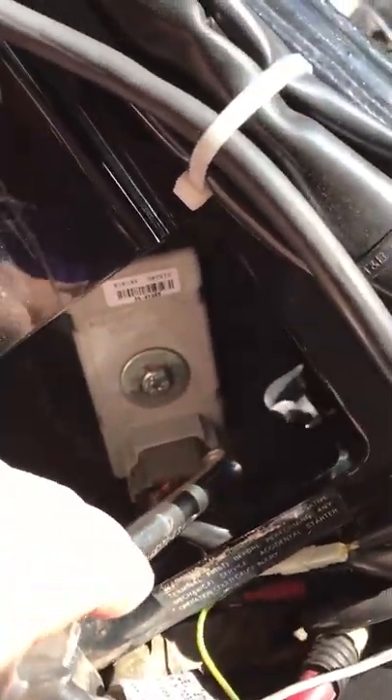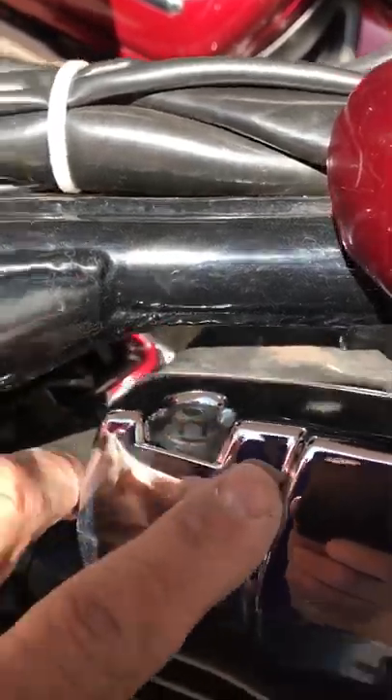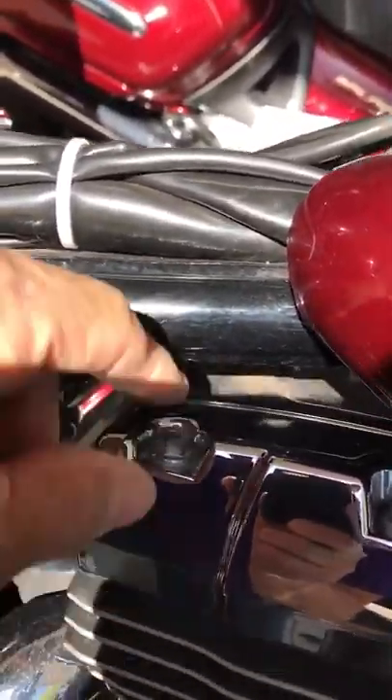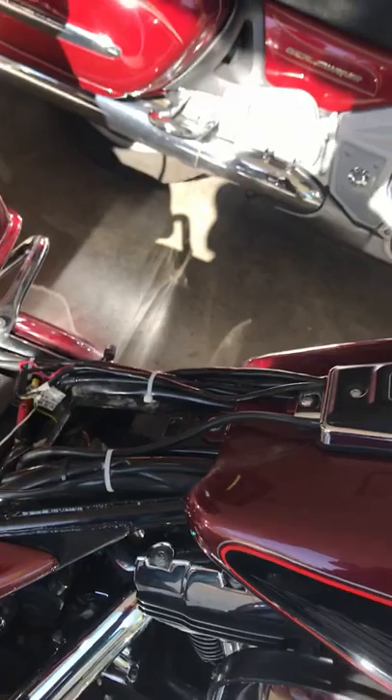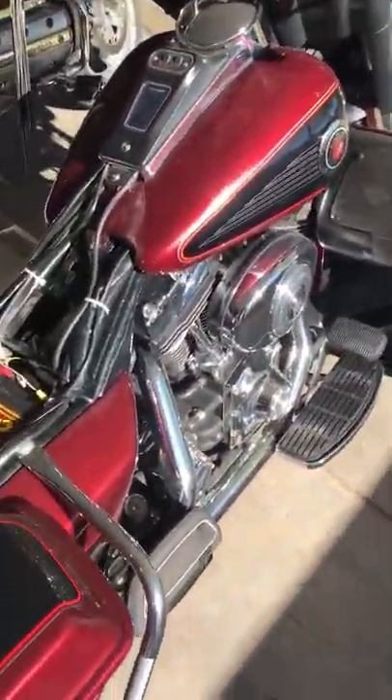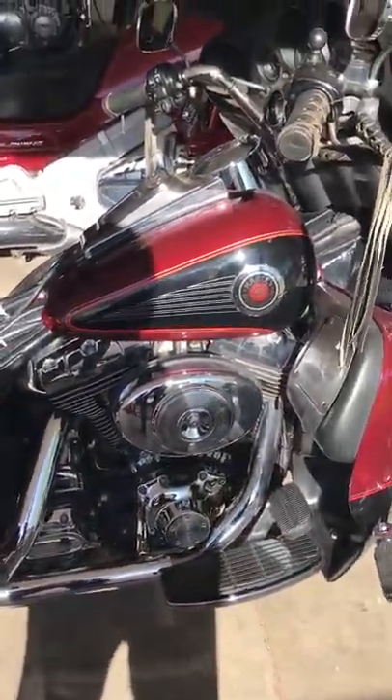You can see those little holes right down in here behind this module. On the other side you've got the valve cover — it's extremely thin in there, you can barely get your finger in. Just on the other side is your module. That's why you're losing turn signal modules — they overheat from the valve cover proximity. So if you've been having trouble and nobody can tell you why your turn signals quit working, now you know how to fix it. Hope you enjoyed this video; if you liked it give me a thumbs up, maybe subscribe to my channel. Thanks for watching!